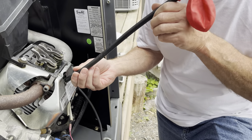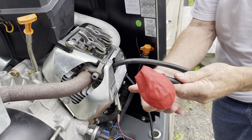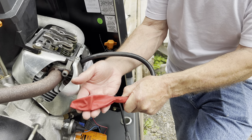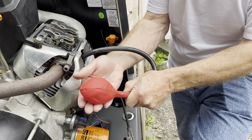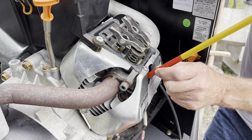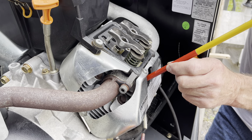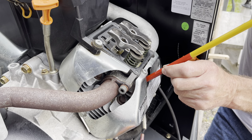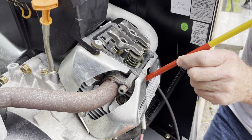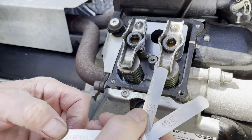This is one way of checking for top dead center on the compression stroke. I have my compression gauge set up with the gauge removed from the hose, and on the end I put a balloon so as I come up on the compression stroke it will inflate. Looking at the valves — exhaust opens, intake opens — and when both valves are closed and the balloon inflates you know you're on the compression stroke at top dead center. You can do the same thing with a piece of wooden dowel or a straw. The piston comes up, both valves are closed, then as the piston goes down the exhaust valve opens, then the intake opens, and when both valves are closed again and the piston is coming up you're on the compression stroke at top dead center.